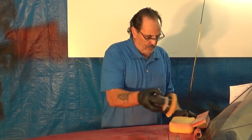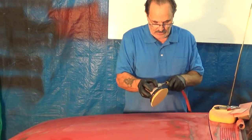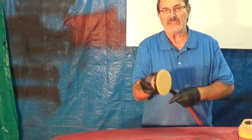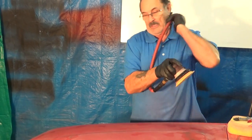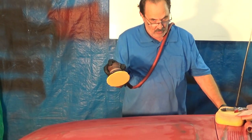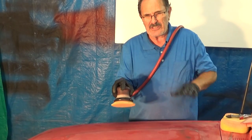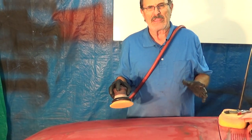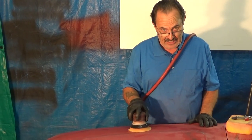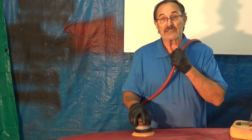Right now I want to use the DA sander with air. You may not have air — it doesn't matter. Basically what you need is a sanding block or something you can sand with. I've got this side over here pretty well ready, and I want to keep my hose off of it because it has a tendency to scratch a little bit. That would probably get filled because I'm using a high-fill primer that is a polyester, two-stage, and it's very heavy — it builds good and sands really good.